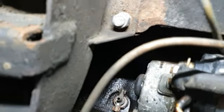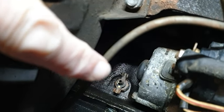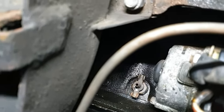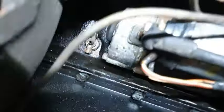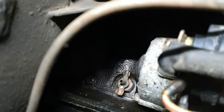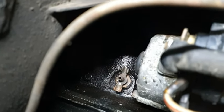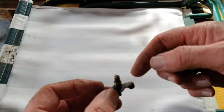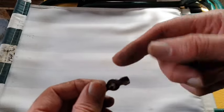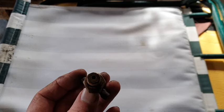Okay, I'm just underneath the car. Something you get on a Mark 1 when you're draining the system — can you see that tap? Basically it's a drain plug, and there's one either side of the casting. I can't get to it with just one hand, so I'm going to need two. It's absolutely impossible — you need a long spanner or something like that to be able to turn it. That's what I'm going to do next, because I want to make sure I've got all of the coolant out before I start to flush. With these drain taps — very simple — you've got a hole just here that allows the fluid to come out, and then that screws into this.